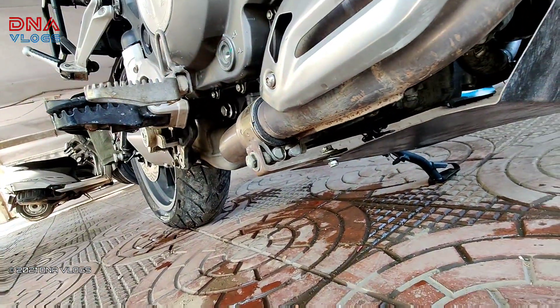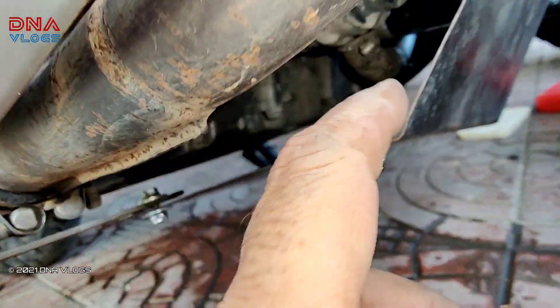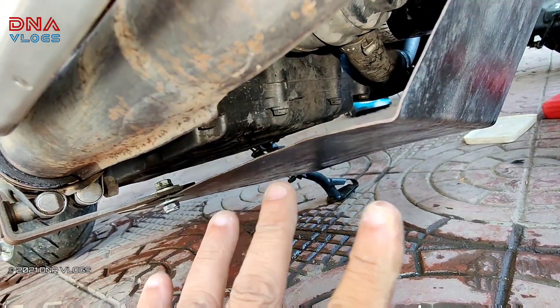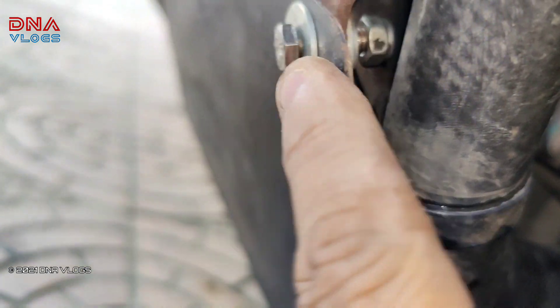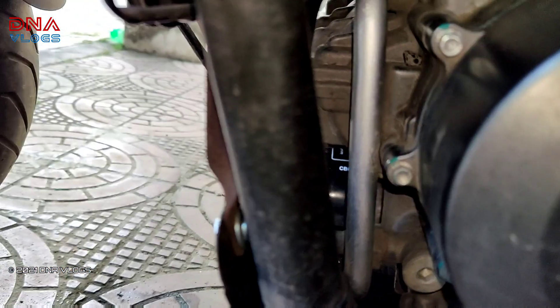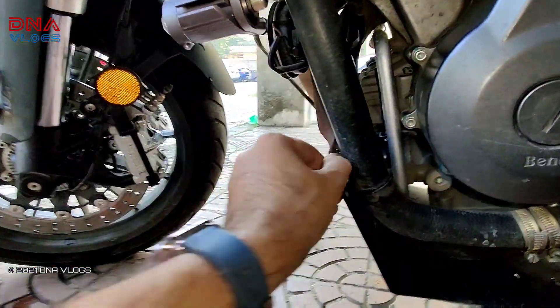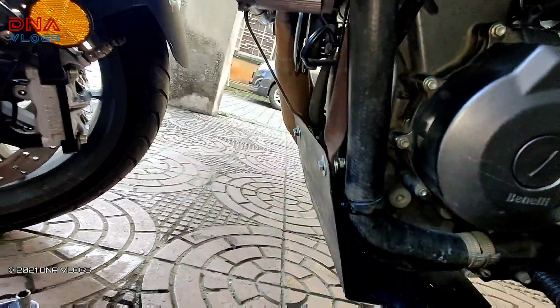The double washers everywhere reduce the vibrations coming directly from this very thin plate. If you use a thicker or aluminum plate there would be less vibration. The third nut and bolt are in place — the long clamp was already there. Once I come back from my ride I'll make this properly and give it a paint job.